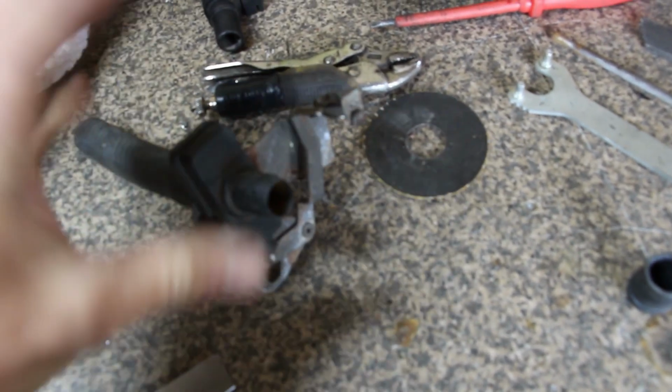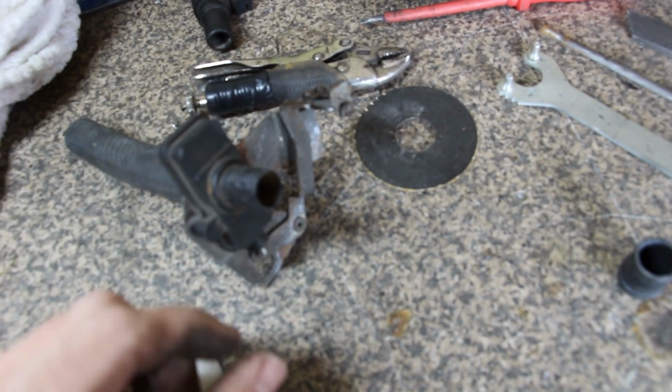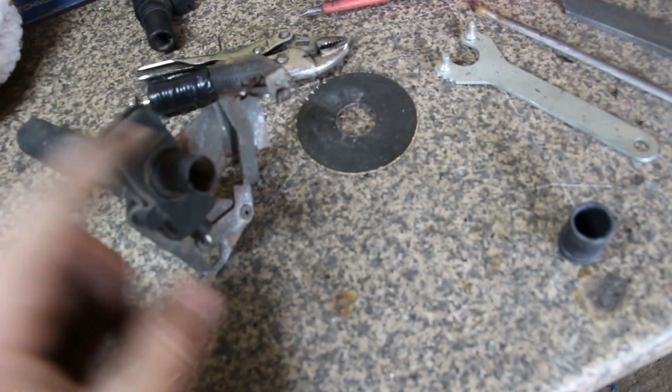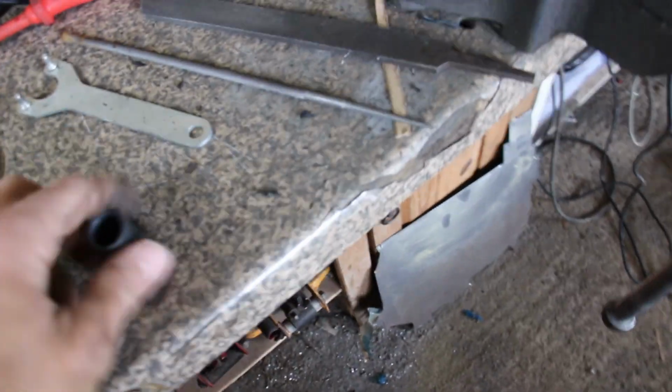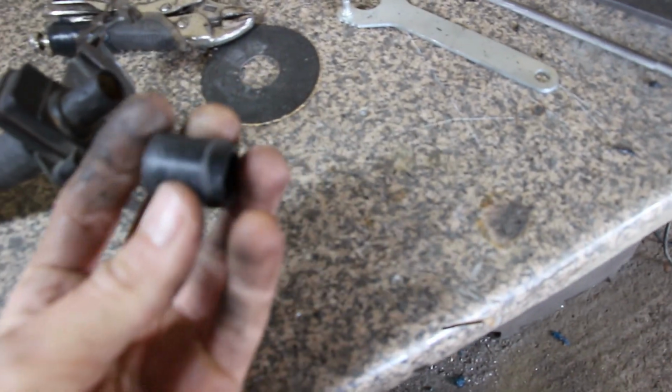So we're going to put the little switch, the mechanical lever switch, in line there, which controls the heating on the Mini. There's not really a spot to put it under the dash, and there's a spot nicely to put it in line. However, it fits our new pipe in lovely, but this is too small for that large hose. It's actually this diameter, it's about 4 mil bigger.